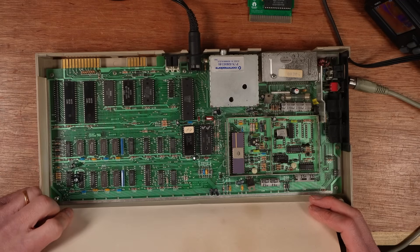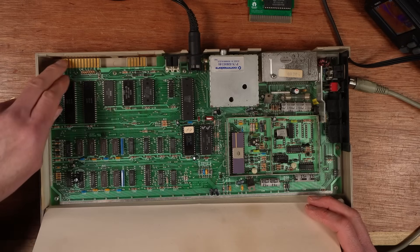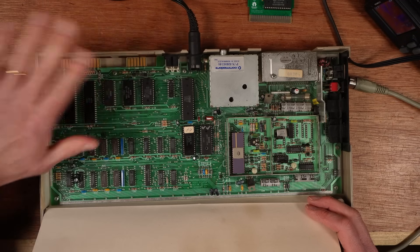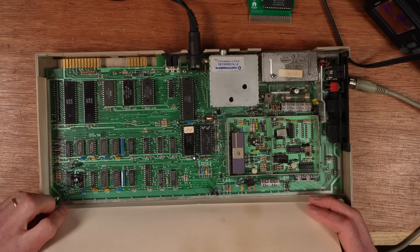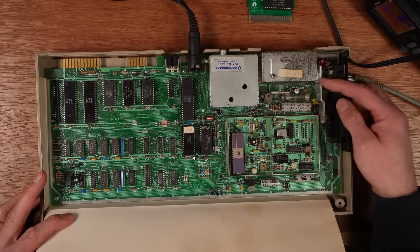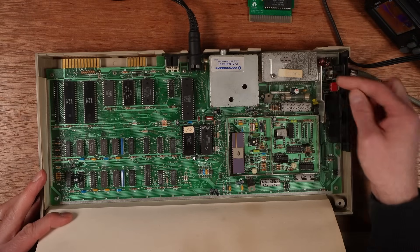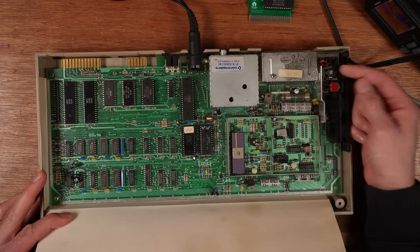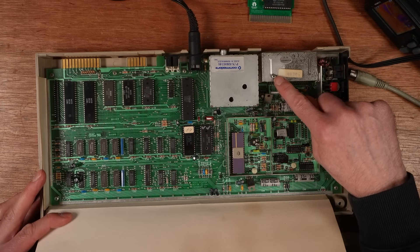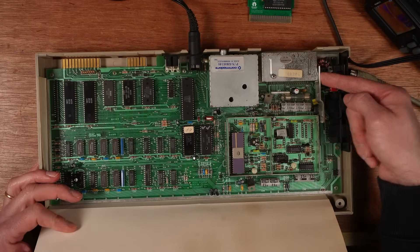So we're around the last quarter of 1982. It's in marvellous condition. There's a little bit of tarnishing on the gold fingers and a little bit of wear on these ones, but apart from that everything is in perfect condition. The heatsink for the 5-volt regulator has got some thermal compound on it and it's been stuck to the cartridge casing, but it's flopping away. If this were mine I would drill a hole and tap it similarly to hold that in place with a small screw.